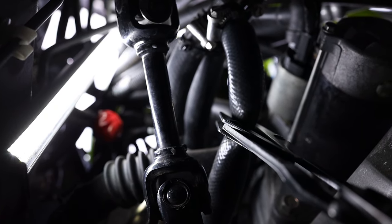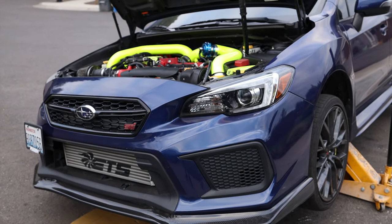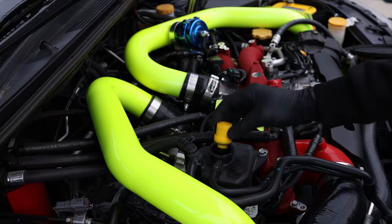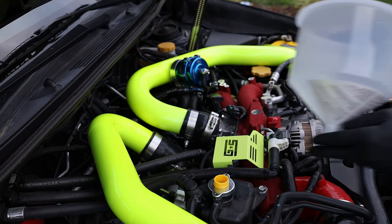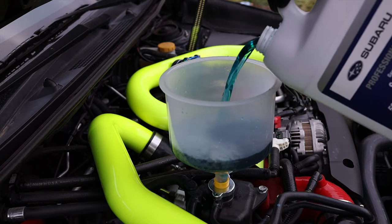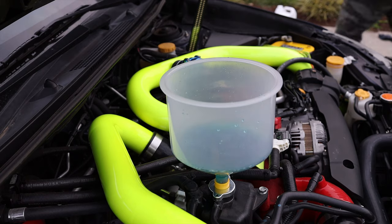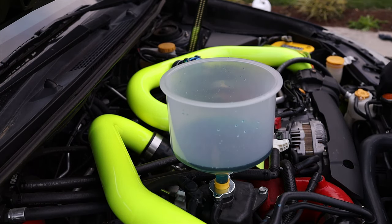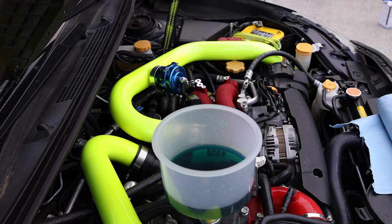The cylinder 4 cooling mod hose is now pinched off. Lower the car and go ahead and fill the coolant into the system using the no-spill kit. Fire up the car, add coolant as needed, and burp the system — also turn your car on to max heat when you do that.